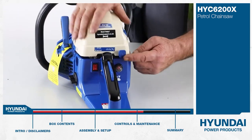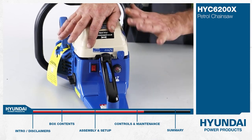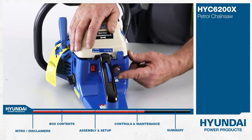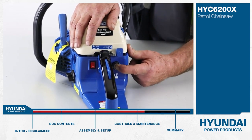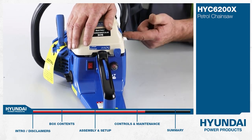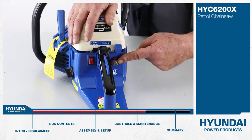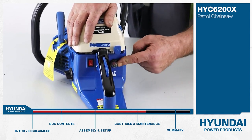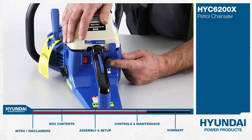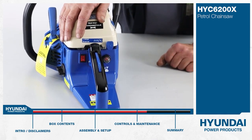Okay, more controls here. This is the choke lever, and this is the primer bulb. So for instance, I haven't put fuel in this unit, but if I had and it was ready to use, I would push this primer bulb several times, and that primes fuel from the fuel tank up into the carburetor. It runs through a bypass and back into the tank. So you'll see this primer bulb fill with the fuel. You'll be able to see it easily because it's coloured with a 2-stroke oil in it. And when you pretty much don't see any more bubbles in the bowl, that's primed, ready to go.